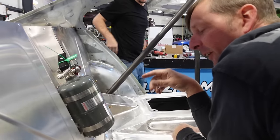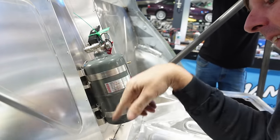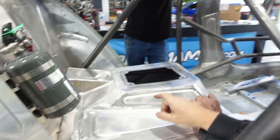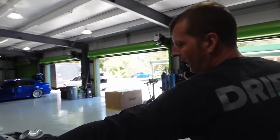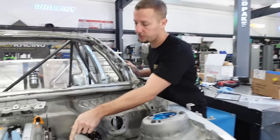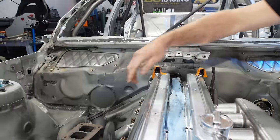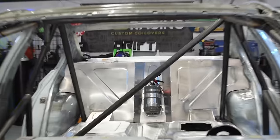We have our Lifeline Zero 360 installed. It's going to bulkhead right back into here, then go down one for our fuel. The rest will go up to the front off the dash bar, pointing towards the driver's feet. Two more will come out — one on this side spraying the fuel rail, and one on the turbo side spraying all the hot and flammable stuff back there.